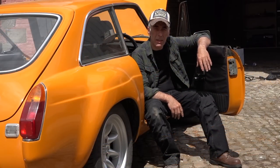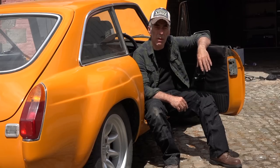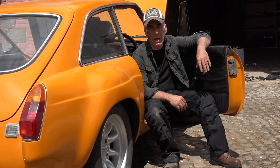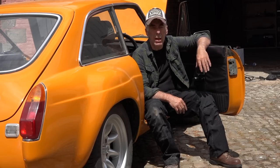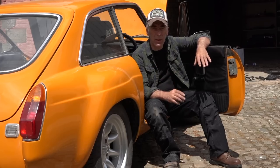So folks, this is the end of this video and I hope you enjoyed it a bit. If you have seen, it's not very hard. Within about an hour, you can get this all sorted out, but make sure that you have your timing marks right. If you have the old distributor on it, do the method with the rotor pointing to cylinder number one. That's a very easy method.